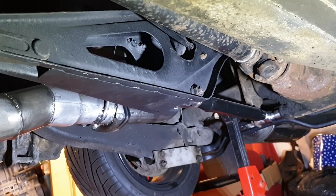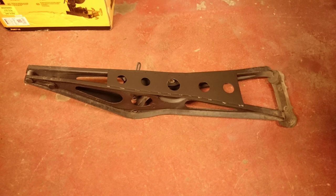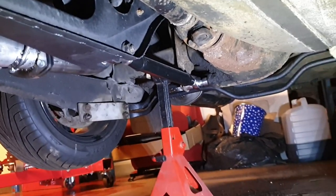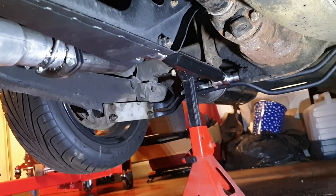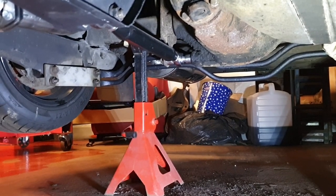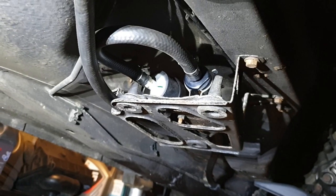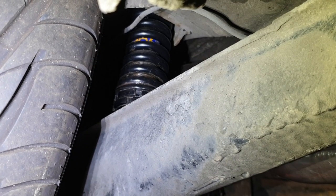You can see I've reinforced the rear axle subframe — there's one plate there, another plate on the back and on the top as well. They sometimes twist when you put a bunch of power through them; I'm not even going to put much power through it but I thought it was a good idea. I've also got heim-jointed rods — another thing from Martin Leaf at Viking Fabrications. The one above is also heim-jointed. You can also see I've got two anti-roll bars — just two standard-sized bars. When you do the maths, it's actually less stiff than having a rear IPD bar. And there's an adjustable panhard rod with heim joints as well. The aftermarket pump and filter are located in the original position, which is handy. There are coilovers in the rear too — they feel a bit soft just pressing the car down, but I haven't driven it yet, so I'll have to see how that goes.